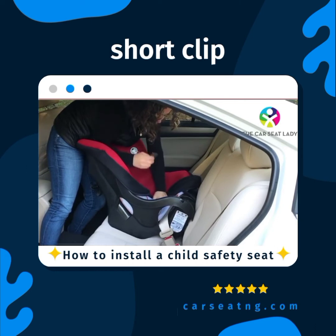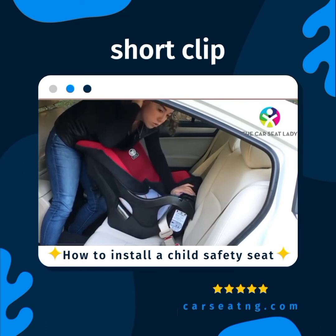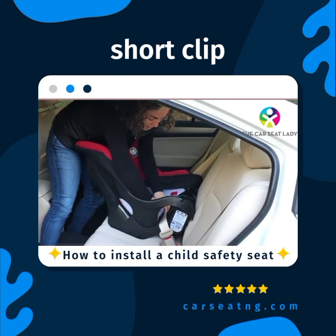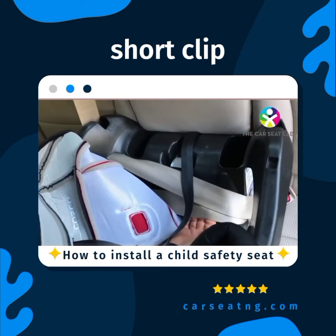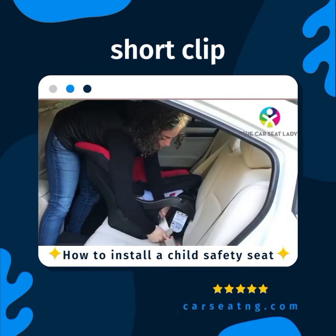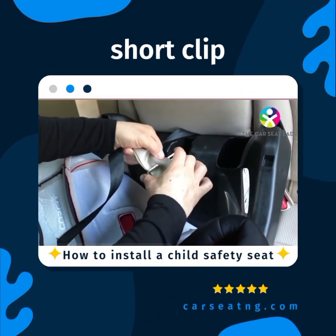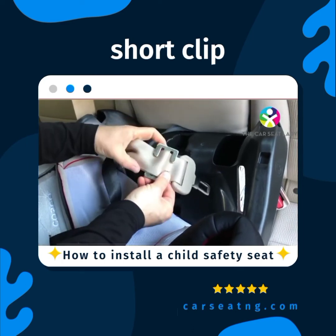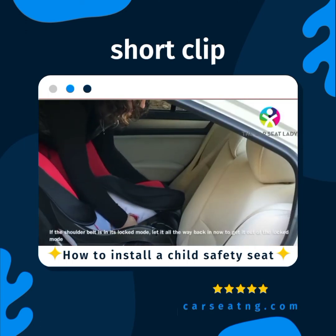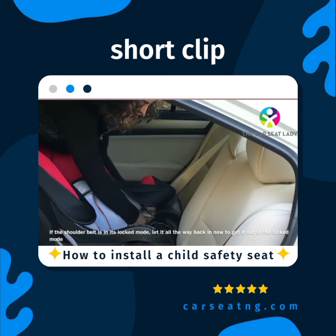Now it's time to put the locking clip on, but in order to get it on I have to have my seat belt unbuckled. If I just unbuckle it I'll lose all the work I've done guesstimating how tight the belt needs to be. So put your hands underneath both belts and pinch together the lap and shoulder belt — just like the locking clip is going to do. Unbuckle the belt, keep pinching, and put the locking clip on starting from underneath. You should see four prongs on the top and a bar on the bottom when you're done. If you have the belt in its locking mode, you must take it out of locking mode — make sure it is out, see how it can be pulled in and out — then thread it back through and have someone help you buckle it.